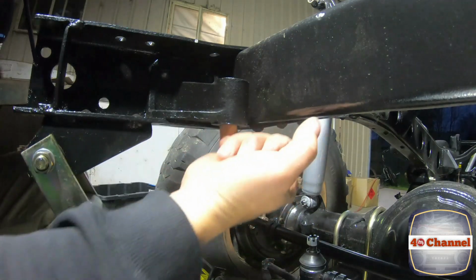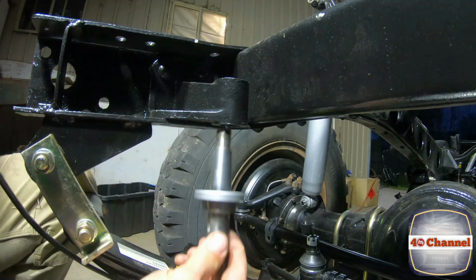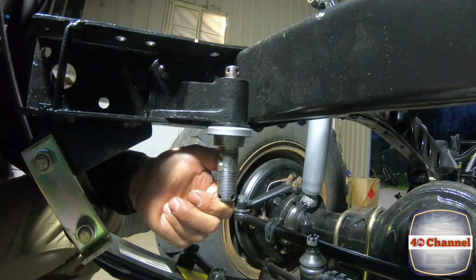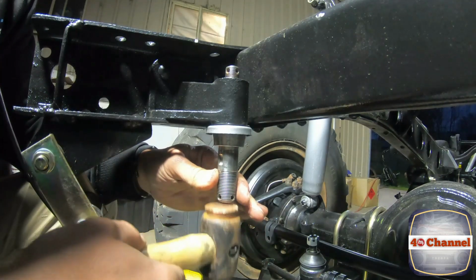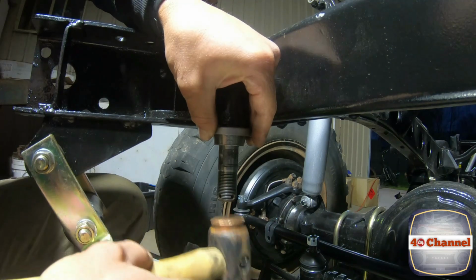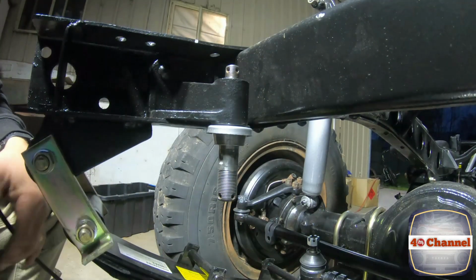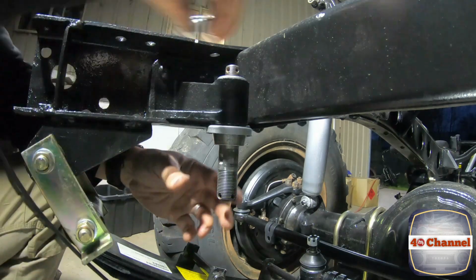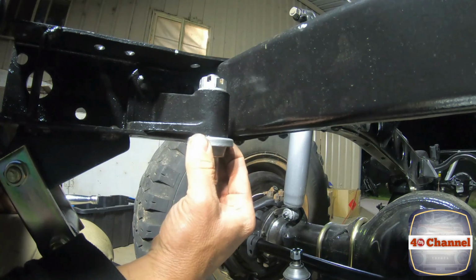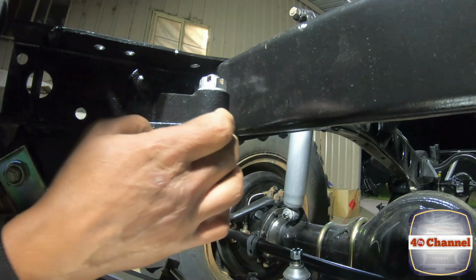Just make sure that's nice and clean in there, because we have this taper and that taper slides straight up into that shaft. We want to make sure that's nice and centered. We're going to get a bit of a tap up with a copper hammer. Gives us a bit of chance to put on our washer and our nut. So I've done this up pretty tight, really tight actually, and I've made it so this here is just moving, so it's just biting down on our lip seal here.